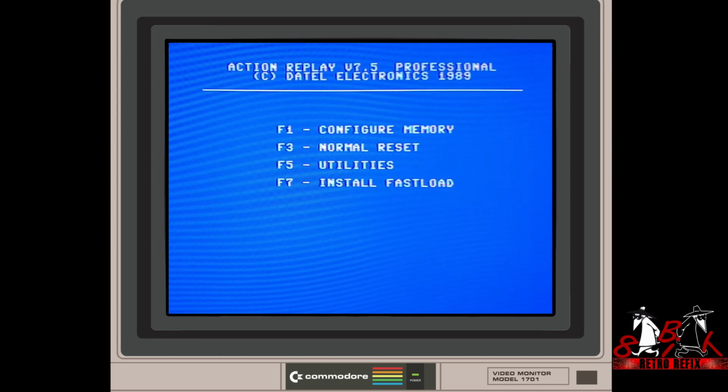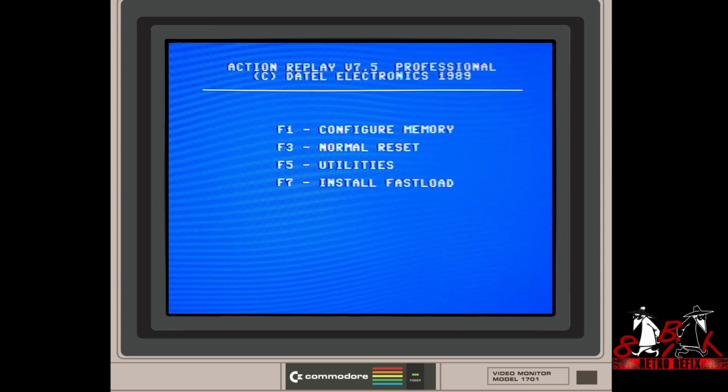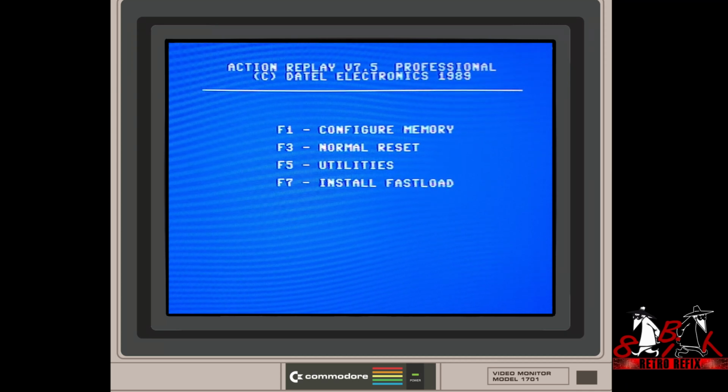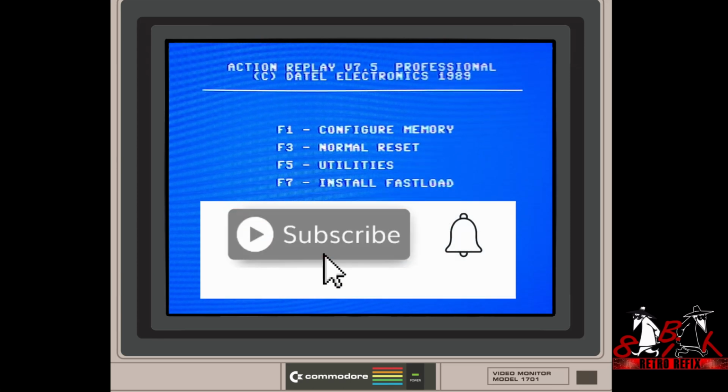If you find the tap file on the internet, that's fantastic, because you can just select it and re-record back over your original tapes to regenerate them, to make them work again, so they're not going into the bin or anything like that. I've done that with a few. I've got about 4 or 5 Ghostbuster tapes. 3 of them didn't work, either side of them, they just wouldn't load anymore. So I restored them tapes using this method.